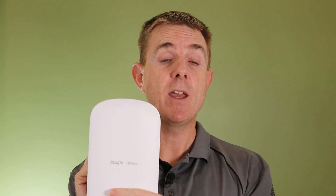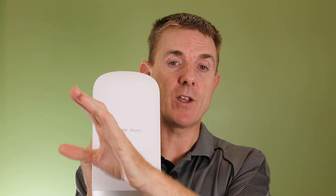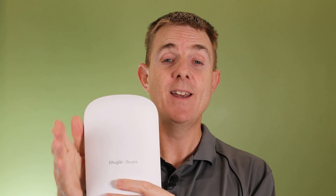These units can be point-to-point — out of the box they will bridge directly — or they have about a 30-degree angle. So if we mount this on our first building and we've got two sheds within that field of view, we could buy two more units and those could then be wirelessly meshed back to this one to create a point-to-multipoint. Or this can be an endpoint for a larger device like the EST-450G, which has more throughput and power. These can then work at their best distance, even up to about 5km, and you may get over 100 megabits a second through that type of distance.